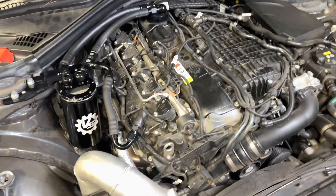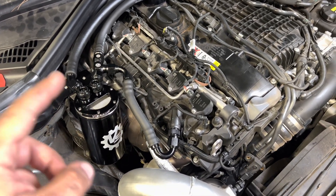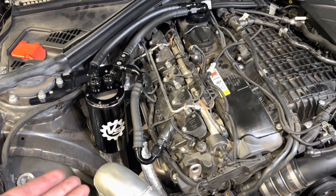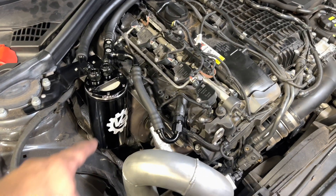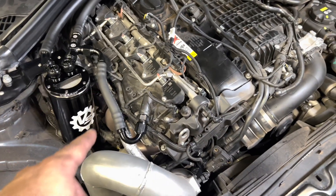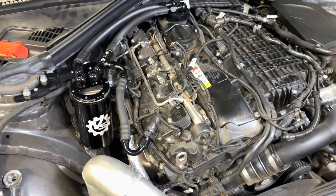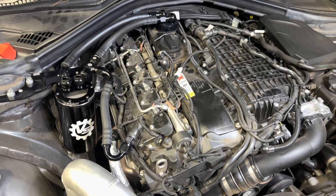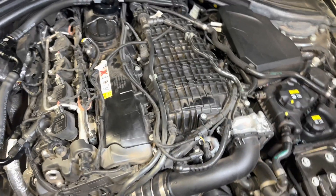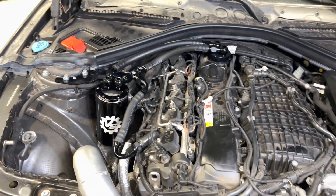Don't be alarmed if you see any smoke come out of that — a little smoke is fine. It's a high compression turbo E85 car in most cases, which is completely normal. It's just relieving crankcase pressure. The best thing about this kit — not only does it have a lot of volume in that can, but it does not recirculate oil vapor. Oil vapor deteriorates octane rating — you do not want that. That causes ignition timing corrections, detonation, et cetera. A lot of people will tell you to just recirculate it — I don't recommend it. On a stock car yeah, but on above-stock boost applications, it's a big hell no for me.